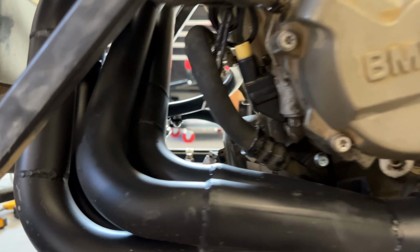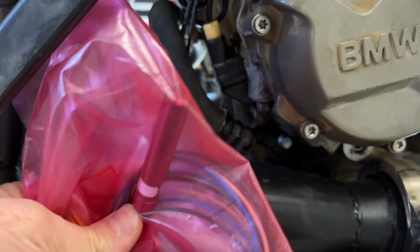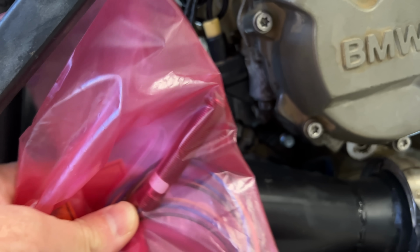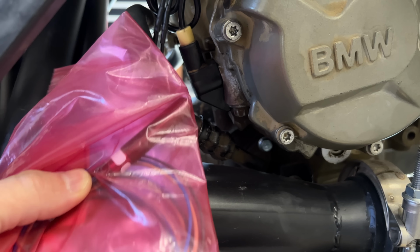The way I saw it, there were 3 possible options. 1, I could swap out the OEM sensor with a new, narrower sensor. This would allow me to move it to the edge of the gear, hopefully missing those 2 partial teeth on the side. I can't get rid of those because they have to be there for the starter to work.